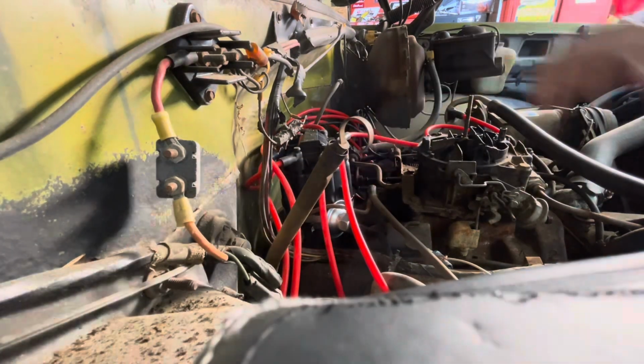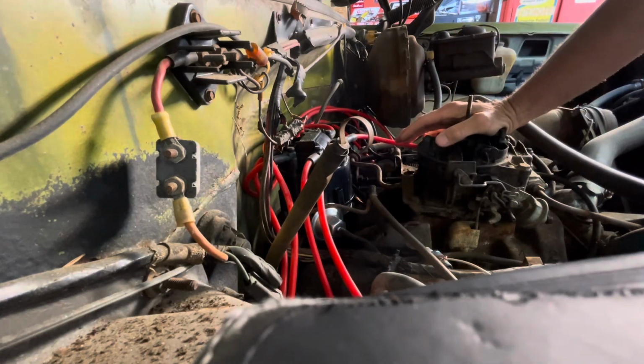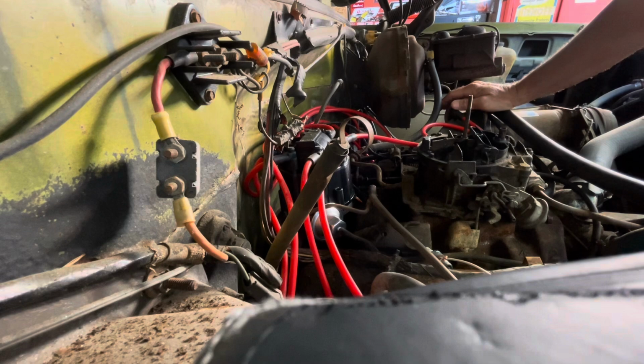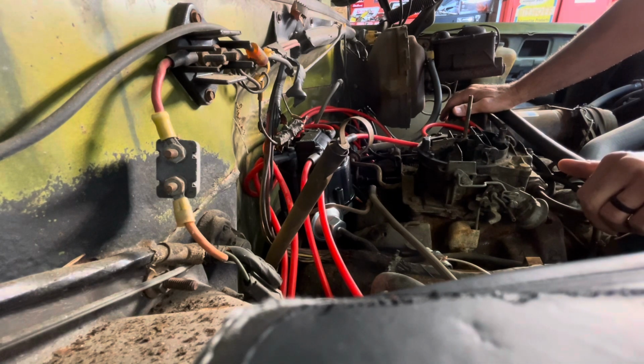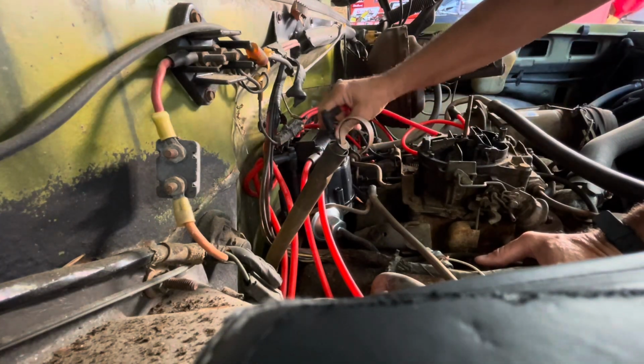Yeah, they got the distributor off a couple teeth. Basically, I'm not able to advance it far enough. So in that situation, a lot of times what I'll do is I'll just move the wires around one spot. But I always get kind of confused. This one actually turns 184. So it turns clockwise. So in order to catch up to that spark or that rotor button quicker, I need to rotate all the wires counterclockwise.